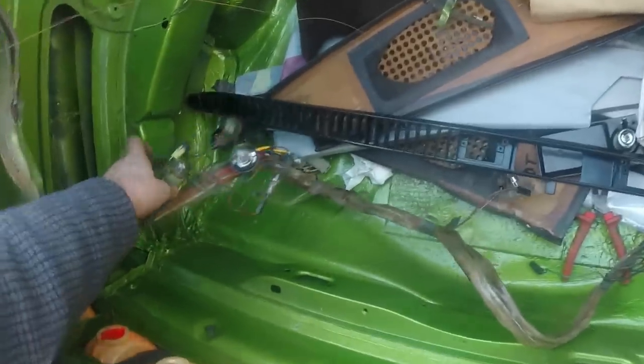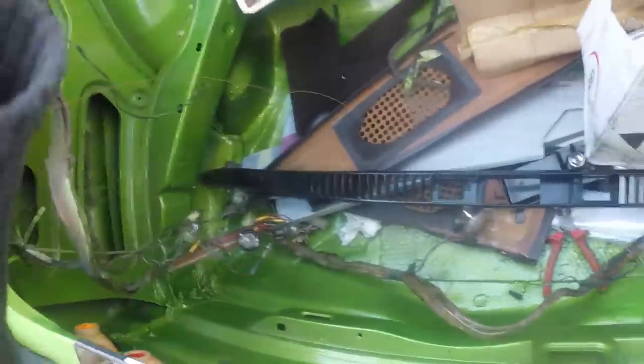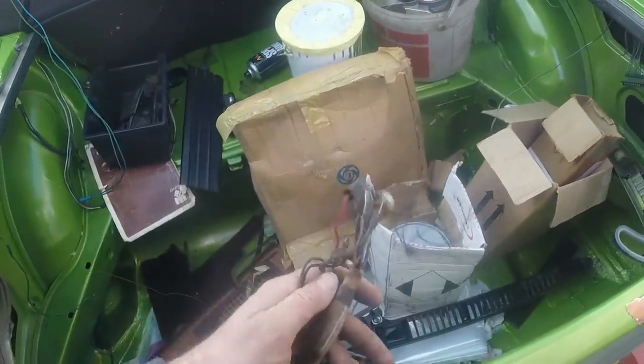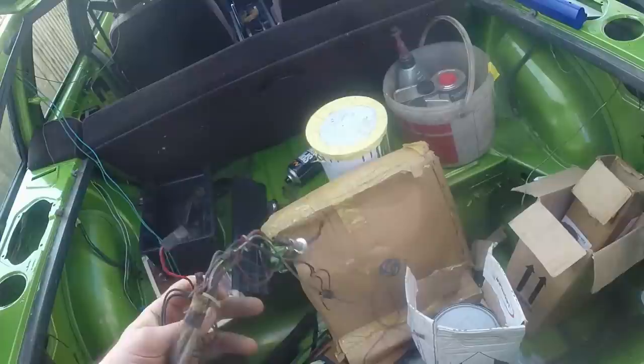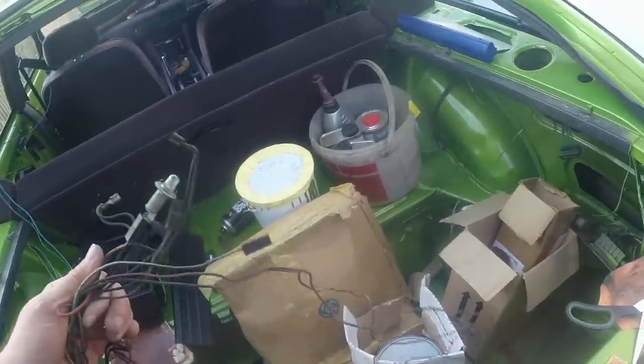I will turn that off for a moment. So all that side's done, new bulbs where I needed them. One I had to put a new earth on because that had split. Haven't checked anything other than with the power probe. I'm going to do this side now. There's a couple of rusty looking plugs which I'll clean up. And I'm missing all the bulb holders, which is quite annoying. But that's the way it goes.